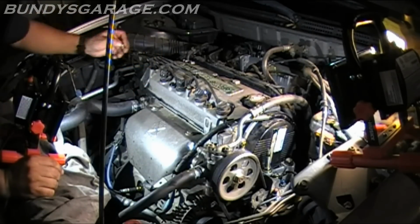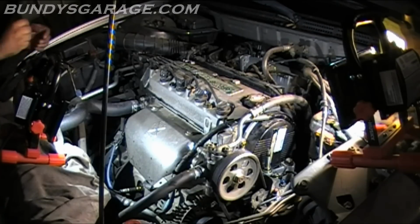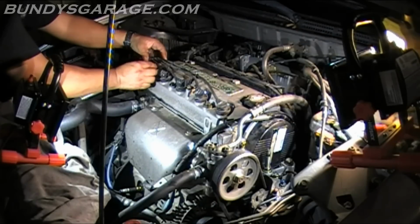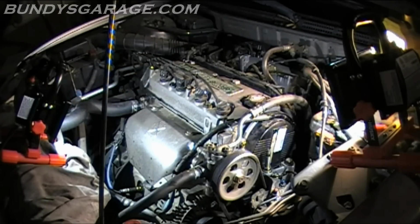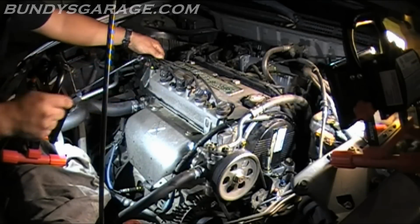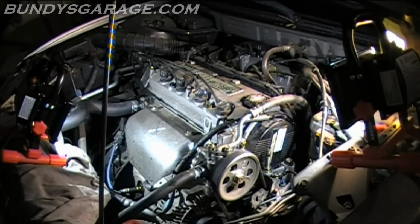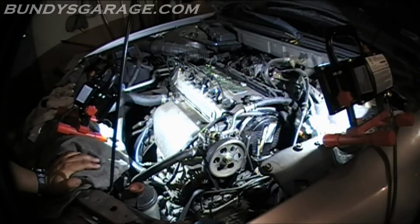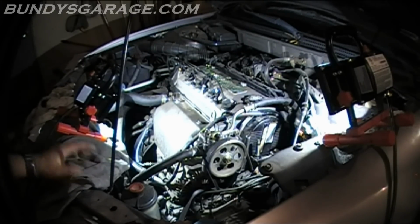This one in. This is a holder for the spark plugs, spark plug wires. Okay, let's tighten those down. Okay, cool. Now put the oil dipstick back in, and the dipstick itself. One thing I forgot to do was install the dipstick tube, so that was kind of a hassle. So remember to install the dipstick tube before you install the power steering pump.